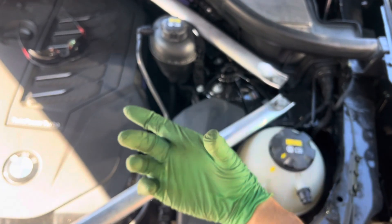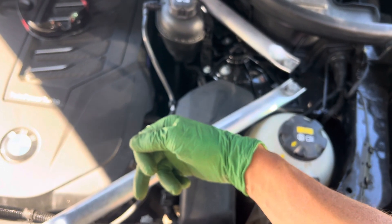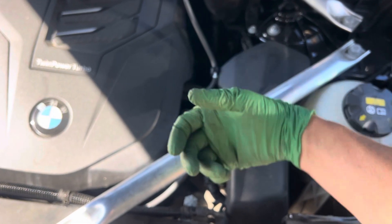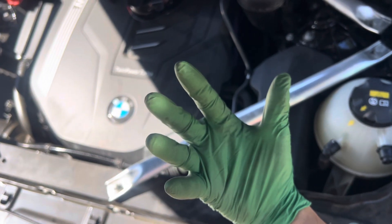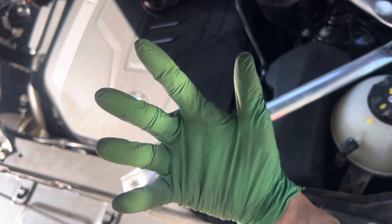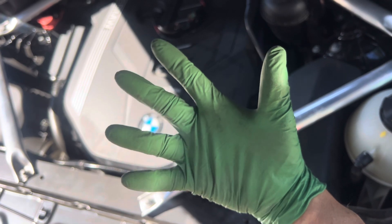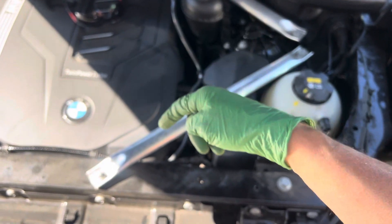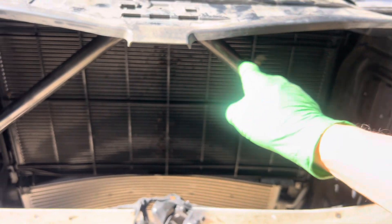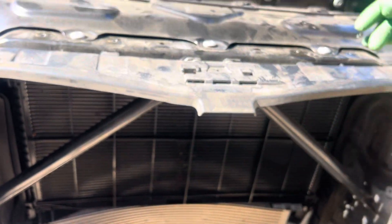It comes out the bottom almost as a liquid, fills up the receiver dryer, pulls the liquid off the bottom, flips back around with the hose, goes back down into a block H-style expansion valve, and injects refrigerant into the plate heat exchanger. It goes up in between the plates — every finger is a plate of metal with hollow gaps. In between two fingers there's cold refrigerant flowing; in between the next two there's hot glycol flowing. That sequence repeats, exchanging heat out of the hot glycol.